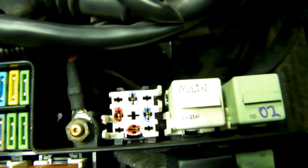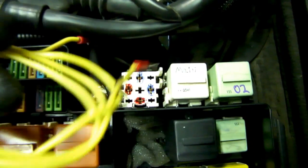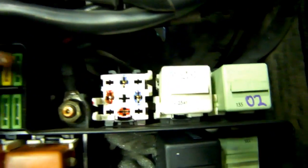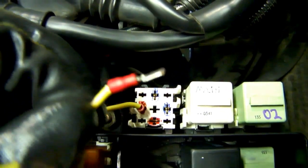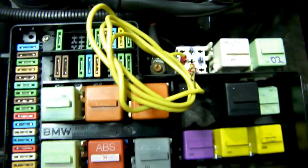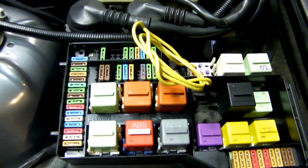At this time, what I need to do is tap in with my wire and bridge a connection. Keep in mind when you tap into terminal 30, which is hot at all times, you don't want the other end of the wire to touch any chassis ground. To turn the pump on, you bridge 30 and 87 together just like this — that's how it should look, and your pump would be on at this point. Now I'm going to mount the camera inside the car and we'll monitor the fuel pressure from there.